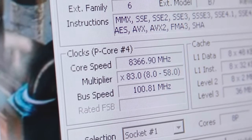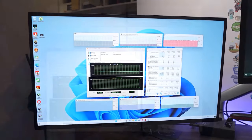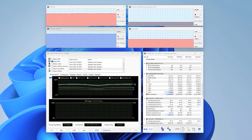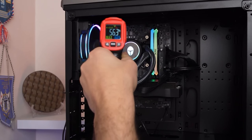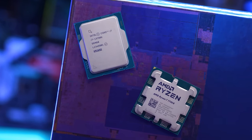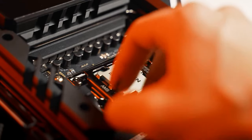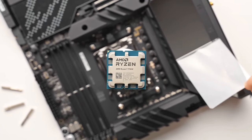By the way, since we have already started talking about the nuances of the motherboard's VRM, they have now become the main deterrent factor when upgrading. The thing is, the basic Ryzen 5 or Core i5 usually do not exceed their 65 watt limits in games and minimally exceed it in productivity tasks, so even simple boards without heat sinks on the power zone can cope with them. The problems start when you try to power up top-end i7 or Ryzen 7 on them, in the case of which the company's boosted clock speeds beyond 5 GHz, generously flavoring it with high voltage and disabling the TDP limit. And to power up such monsters, you need a board with a good VRM, so if you're planning to further upgrade your PC, it's worth checking on the internet how the board you have chosen handles modern top-end processors.